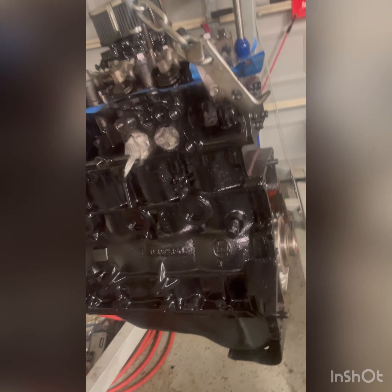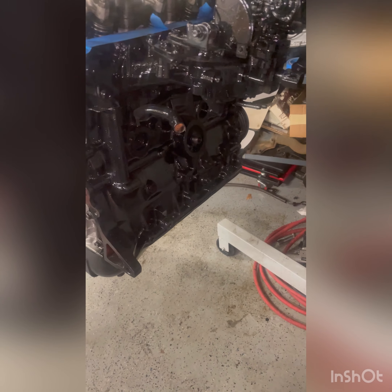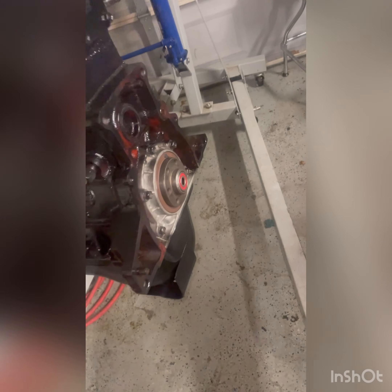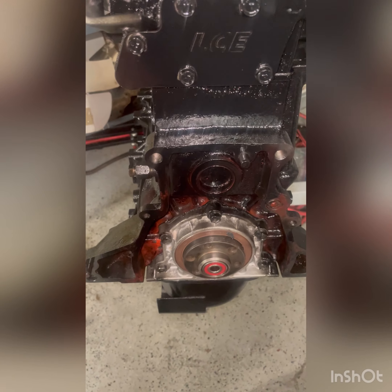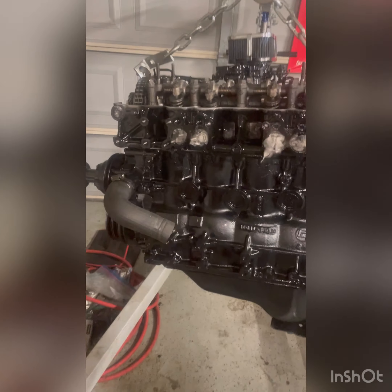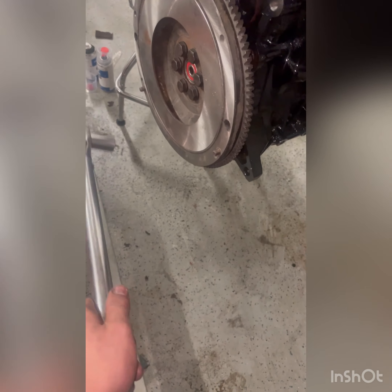There's just one coat so far and I haven't even finished off one can, but overall I think it looks really good - a lot better than that shitty orange. When I get everything put together with the engine in the car it's going to look amazing. Now I'm going to go ahead and put the clutch flywheel together while this dries, then put it back on the engine stand, make sure everything's painted and looks good, and then this will be done and ready to put in the Toyota as soon as it stops raining. You need to make sure you torque these flywheel bolts down - mine is to 80 foot-pounds. Look up your torque specs. I sat on the floor, put a bar on one side and something on the other side to keep it from spinning while I torqued it.